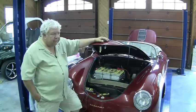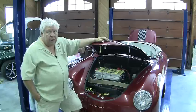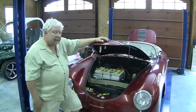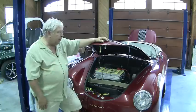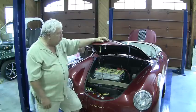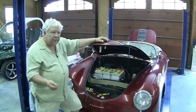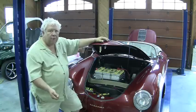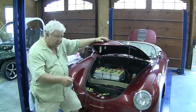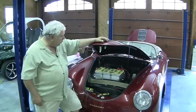In adding two batteries, we kind of have to get them in tune with the rest of them. I do this by charging the whole pack until it's in that sensitive zone, about 3.75 volts, where we start to see large differences between individual batteries. Then I take the batteries we've added and either use a resistive load to bleed off some energy, or a simple 12 volt charger to add a little bit. It's kind of a manual process, but you usually only have to do it once.